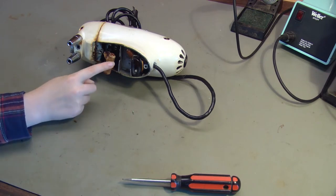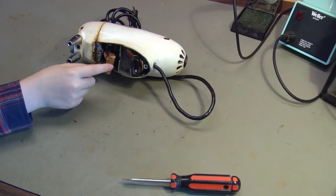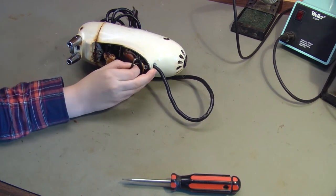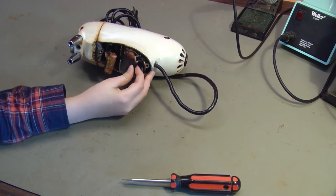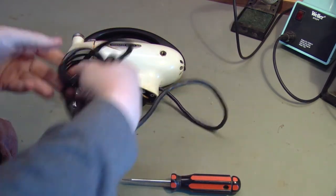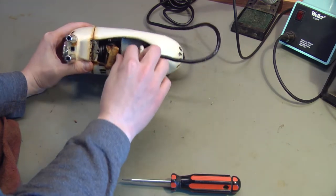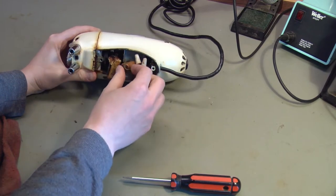The wiring here is damaged very badly. We found out it was damaged when we were checking it out because we thought it would be nice to replace it. The insulation just fell right off the wire when we touched it earlier — it wasn't even a pull or a push, it was just a tap. So we need to replace this whole line cord, which is no big deal. We'll throw a new line cord on it. The wiring going down into the motor is probably going to be okay, and the capacitors will have new wires, so that won't be a big deal.